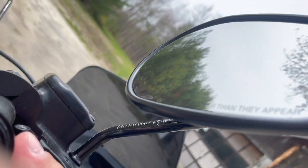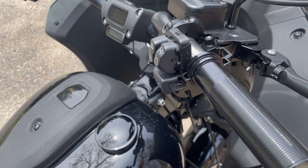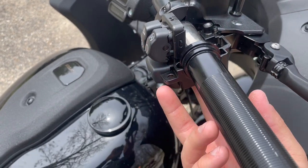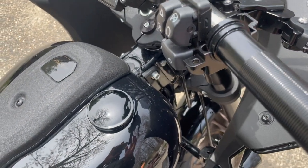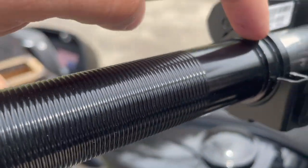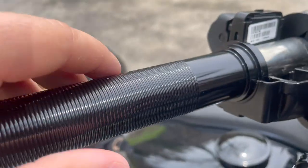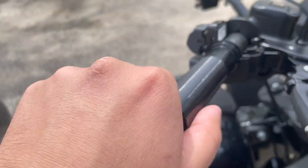You just want to play with this a little bit — it's a tight squeeze in there. I cut the camera because it takes some fighting. What I learned is if you pull the assembly back down without the throttle tube on first, you can slide it all on together. What you're looking for is this channel right here to actually sit inside the whole assembly — that prevents it from popping out once everything's tightened down.